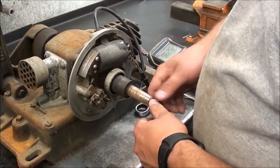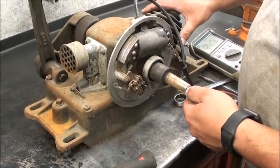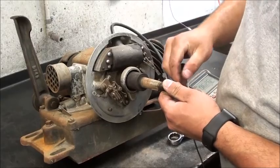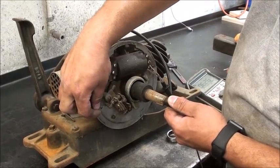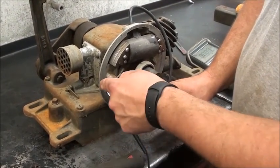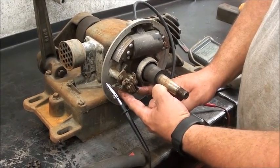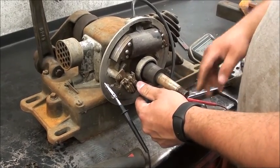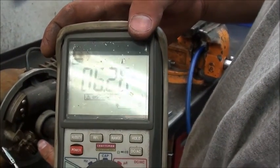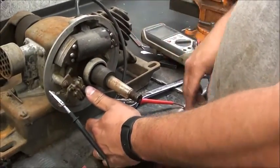Now there's one more side to check: from the plug wire to the wire that runs to the points and condenser. On this particular engine somebody has already removed the condenser. So the easy way to check is to isolate the points — open them so they're not touching anything — and hook our wire to there. The points have to be open and we have to unhook from the condenser; if you don't, the condenser will show a false reading and it'll show ground. Looking at our meter again, we see the same reading — they should match or be very close. So it appears we have a good coil.